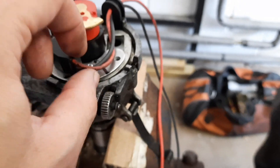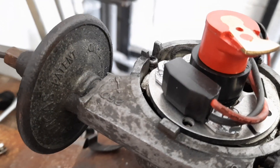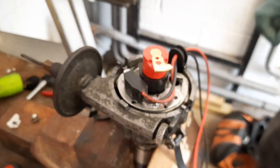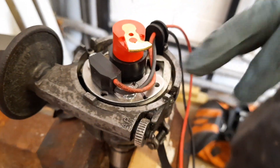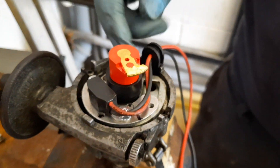The module is now fitted. From the original shot we know the rotor arm was pointing a certain way, and we needed to align with the new collar — called the magnetic ring — to make sure it was exactly in line. We made a mark here and a mark here, and confirmed the rotor arm is pointing the same way as when we took it out. The last thing is fitting the grommet into the housing the right way, and making sure the cable doesn't touch any rotating part, since this whole thing spins. Dave's got a nice bit of clearance there.